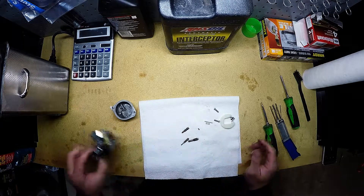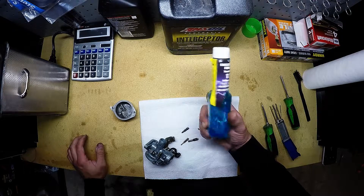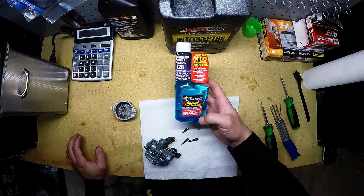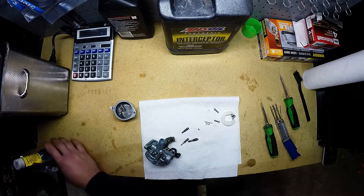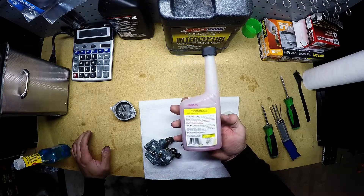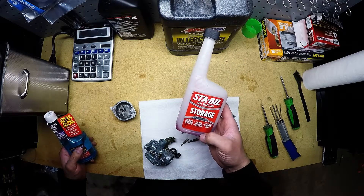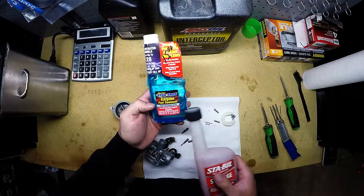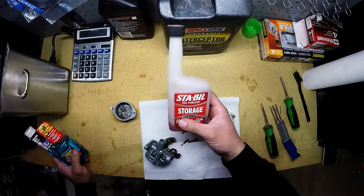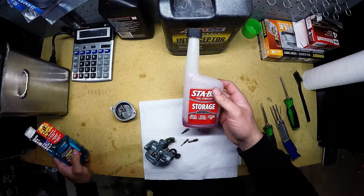One thing you can do to make this stop happening is to use fuel stabilizer. This stabilizer here is more of an all-around use — you put this in your fuel all the time, run it all the time, and it kind of eliminates the problem from ethanol. If you're going to store it, typically I use something like this — fuel stable storage — this seems to work the best. You can run this kind of in there all the time, and if you're going to store it over the winter time, slap some of this in there. Just make sure you read it because this stuff treats quite a bit — this whole bottle will treat 128 gallons, this one treats 25. So this one you need to put a little more in there, maybe like a shot glass, in a lawn mower, snow blower, or all these little four-wheelers — it'll do the job for you.